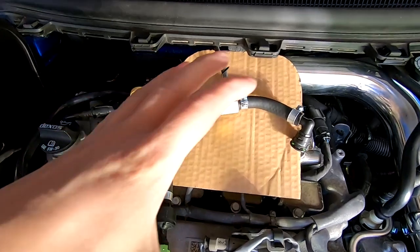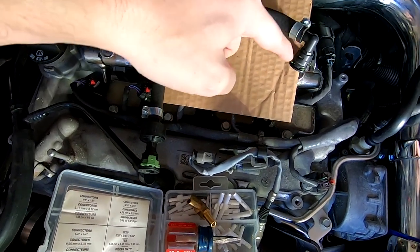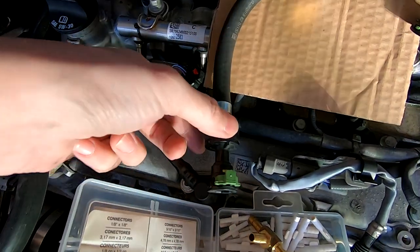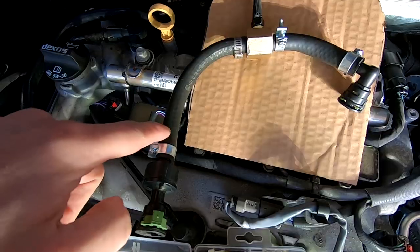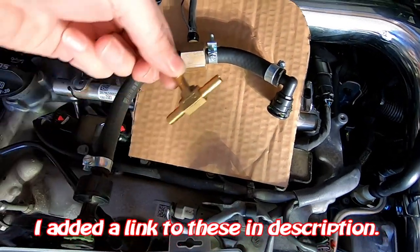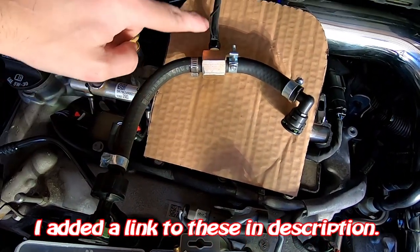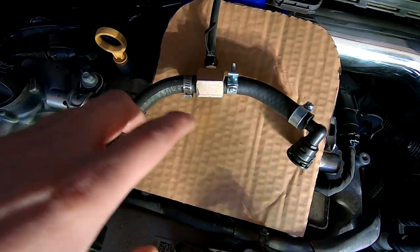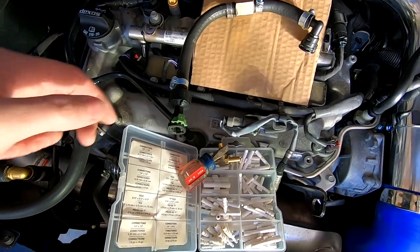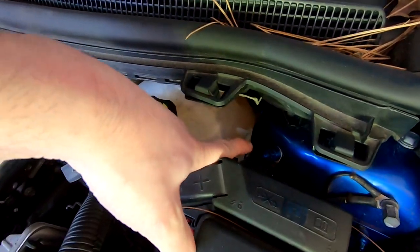I isolated the hose that I made. This hose originally was U-shaped — it would go from the back of the intake manifold, make a U, and then go right to the back of the throttle body. To get this off you have to do it by feel. I took a small screwdriver, pop up the green tab, and these literally pop off. Once that's off, cut the plastic pipe. Then I used 3/8 tubing. I have a heavy-duty fitting here — an old gauge fitting — but you can get a regular aluminum tee or a plastic tee kit. Make sure it has a 3/8 to 5/16 adapter so you can adapt down for the gauge hose. To put this back in, just pop it on and push the clips down.